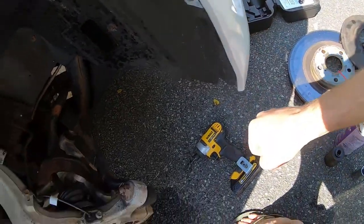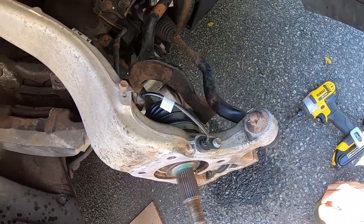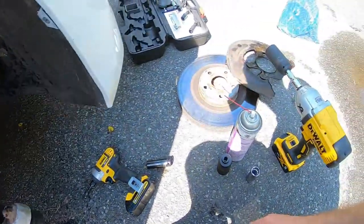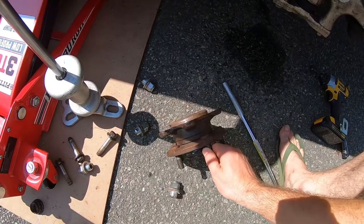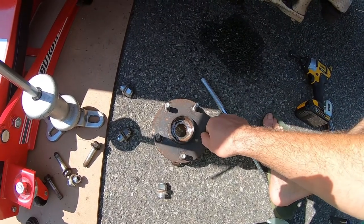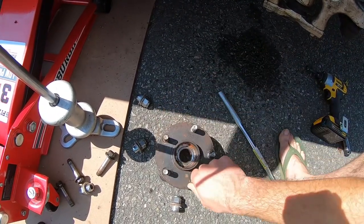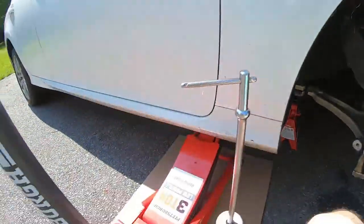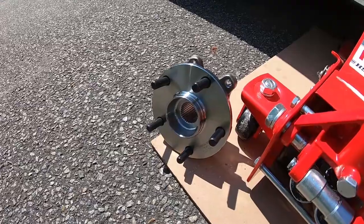I once changed wheel hubs on my BMW and it took me five hours on the front ones using breaker bars — so I suggest you spend the money and get an impact, it'll make your life so much easier. The actual hub I've driven on it last week, and the wheel on the hub is just sliding up and down and moving around a lot — that's dangerous, the wheel can come off. So this hub is completely dead. The replacement I'm using is a Moog — they're not expensive, about $150 each — we'll see how it holds up.